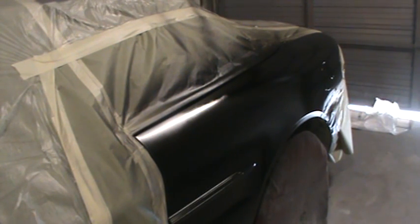So a 30 gallon tank is pretty small unless you're doing small repairs. To get around the whole car, you might have a hard time. You might want to invest in either another tank, if the compressor is big enough to fill the capacity of another tank, or maybe possibly another compressor.